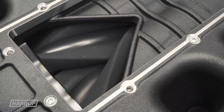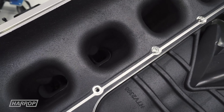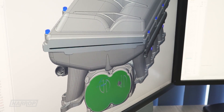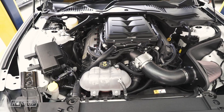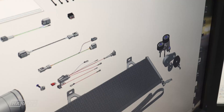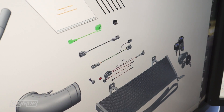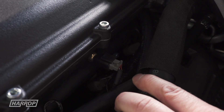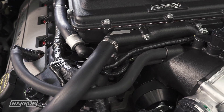We have positioned the rotating assembly as low as possible with the discharge port facing upwards into the large manifold plenum, prior to the intercooler core, before it passes through the core and into the four cylinders on either side of the engine. All factory accessories like aircon are retained and no cutting or fabricating is required for the install. We supply three extension looms covering fuel purge, throttle, MAF and intake air temperature — which is removed from the MAF card and measured from a new sensor post-intercooler to measure actual IATs — along with relevant molded hoses.